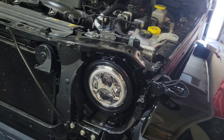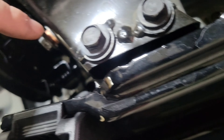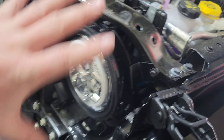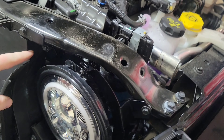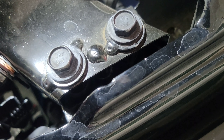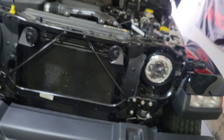Washers are in — it did push out the headlights a bit. It's not going to be fully sealed, obviously, but I wanted to improve it at least a little. I did have to use two of the same sized washers on one spot because this insert is angled, and I used a bigger and a smaller washer on the rest. All of them are the same thickness — you want that because you don't want to change the geometry of the mounting bracket, which would change the geometry of the headlight. So instead of using a small and a big one where the holes are straight in, I used two big ones there so the washers sit straight.